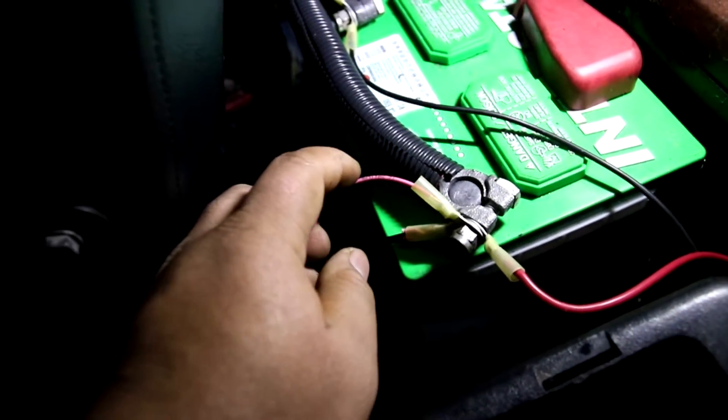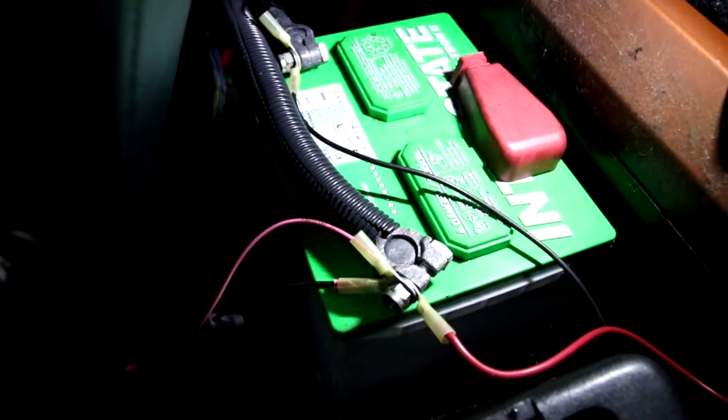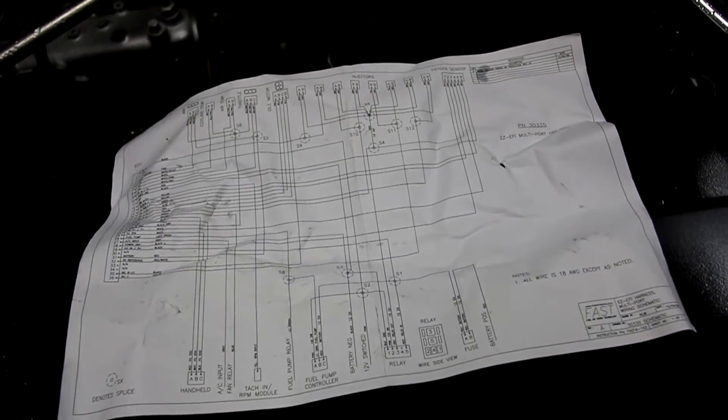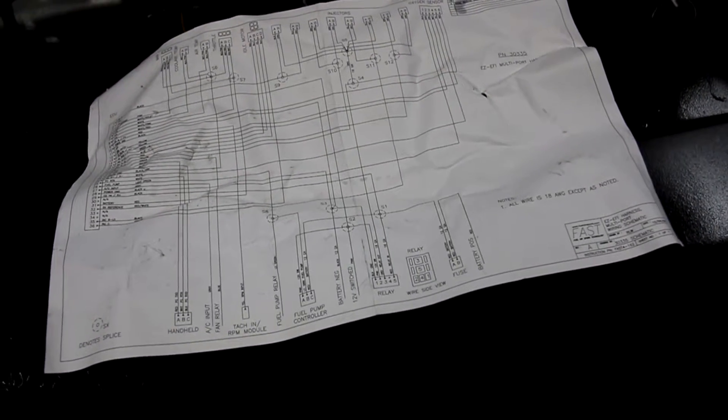This pink wire is your 12 volt. I have it to a switch, so I hit the switch and it turns on everything. Or you can just find the wire that is activated with 12 volts. Now the hard part about wiring: since you're not going to be using your old fuel pump relay, you have to get a new relay and wire that up. There's a wire that comes off the harness labeled 'fuel pump' — you hook it up to a relay, and then get power, ground, and 12 volt to that relay. I'll put up a clear diagram so you guys can see what I'm saying.